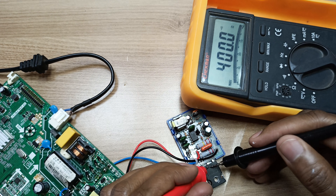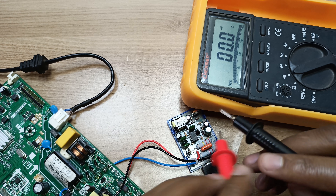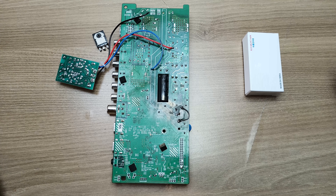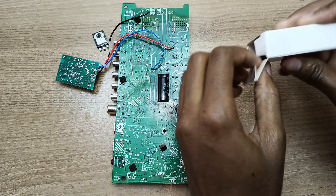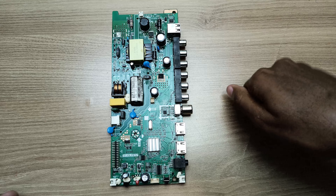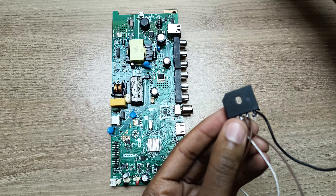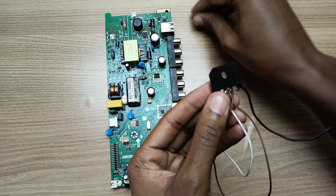Before I plug in this machine, I want to address another issue. The blue wire is not supposed to be connected to the cold side of the power supply. Instead I should have connected it to pin number 4 on the hot side, and I'm just going to do that now. The way these power modules are designed, it's not a must to use this blue cable, but it's good practice. I don't know if this is what led to this TV blowing up, but I don't think so.